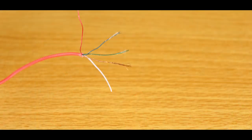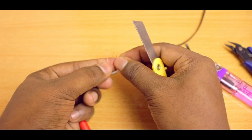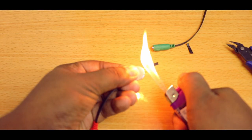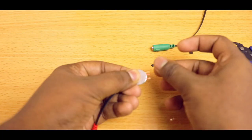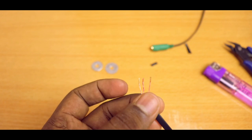You may notice that all the wires are touching each other without any plastic covers. All these wires are coated with an insulation material. You don't need any special tools — you can use a blade or expose a few millimeters of the wires to a flame to remove the coating. Now you can solder it without any problem.